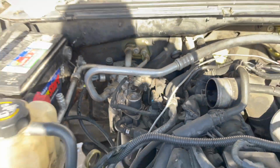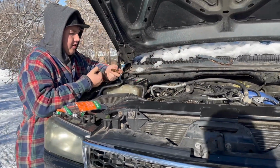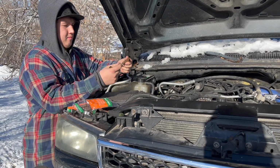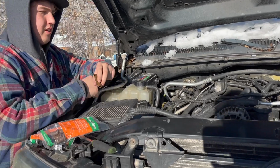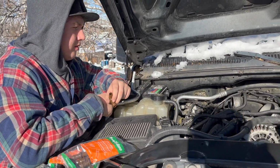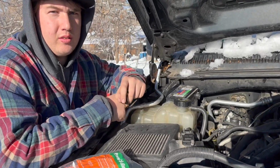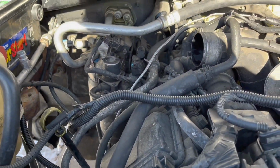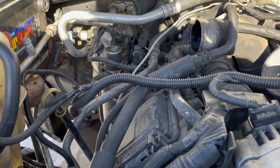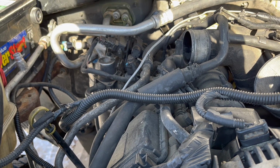I think we're having some fueling issues with it, so we're just gonna do the redneck delete on it and just get some of these and cook them in, and then it'll just flow straight through those instead of going through the fuel filter head. We'll stop having to deal with issues with that thing. We have an air dog on the truck, so no need for it. Not a big deal. These things cause way more problems than they do good. So got a lift pump, and then we'll go from there. I think we'll see if that fixes the fueling issue.